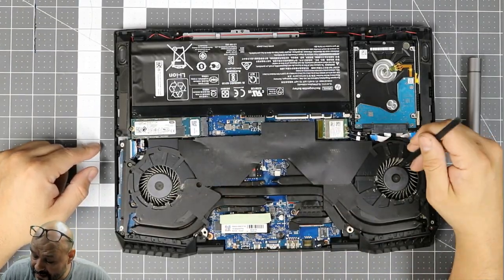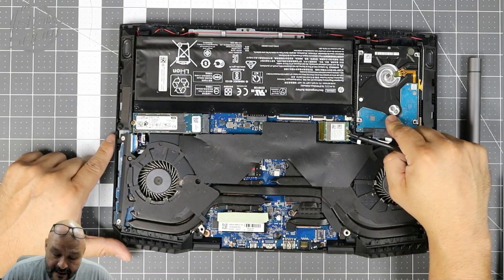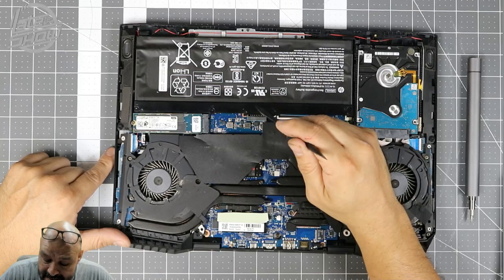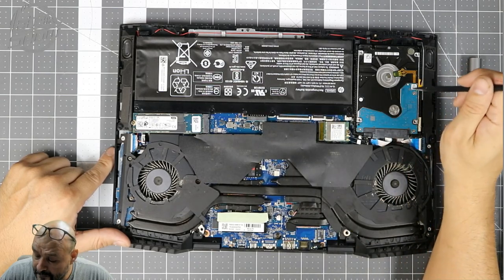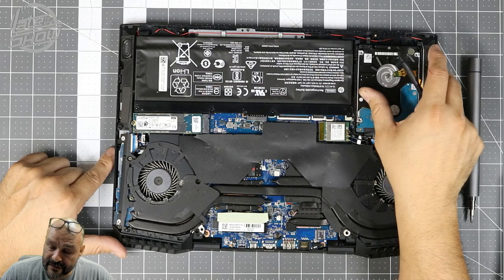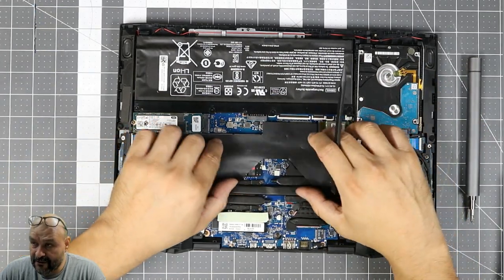This has been in use and it's collected a lot of dust, so I'm going to bring it back like a brand new machine. We have an extended hard drive in here — M.2 of course. On this side, the battery is very simple to replace with a couple screws. Make sure you always replace the hard drive by getting an M.2 slot drive — they sell a converter from a SATA drive to M.2. There's only one slot for an M.2, and the memory is hidden in the back.